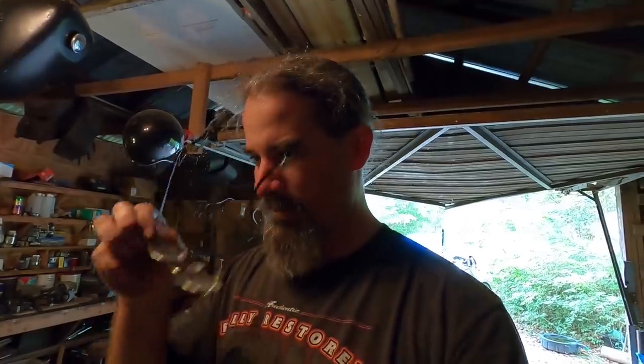But yeah, that's it. Here we are. My primary is all taken apart. Transmission's been gutted out. And I'm currently waiting for another one of these, except the 74 and earlier version. And the brake pedal that would go on the earlier version crossover shaft. And that crossover shaft's coming with all the brake rods and stuff, so I can run my rear brake with brake rod linkages, that type of scenario, instead of cable, because cable, I just don't like cable. You know, for a scenario like that, because cables are notorious for slipping, breaking, and stretching.